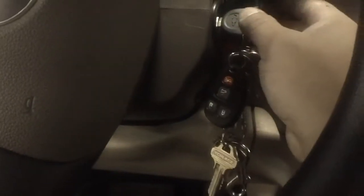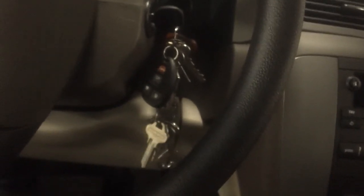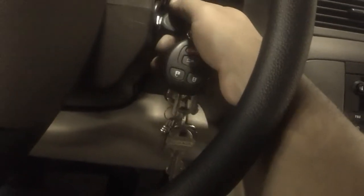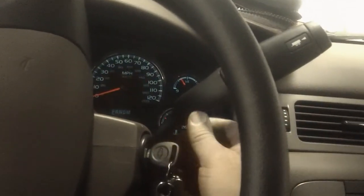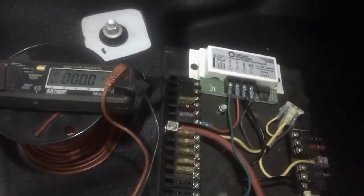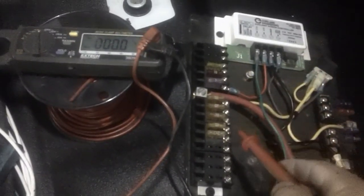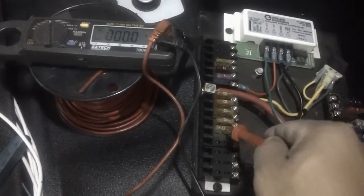That's something you guys should be aware of — if you're just sitting down idling and you want to conserve some gas, it's nice to have it in just the accessory position and not the engine run position, which draws more battery power. In accessory mode, you only have your accessories on. So now I've got power hooked up. This is my constantly hot terminal strip here and they're all fused with regular blade automotive fuses.